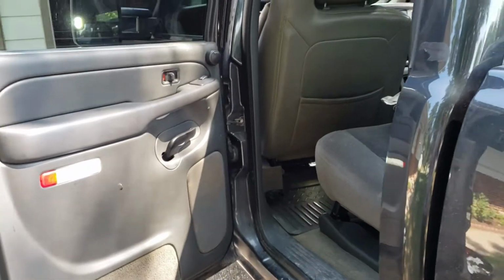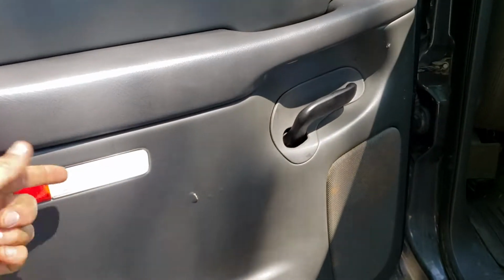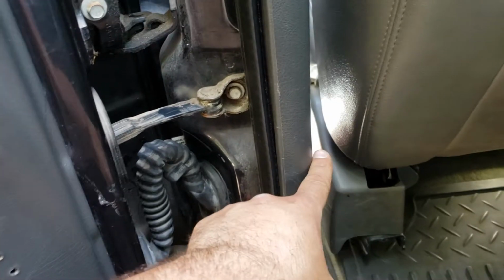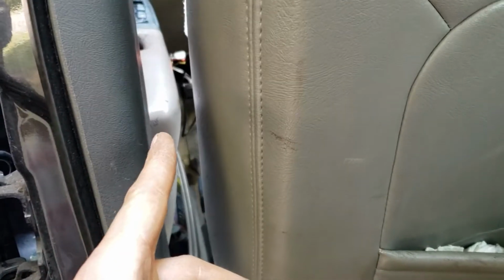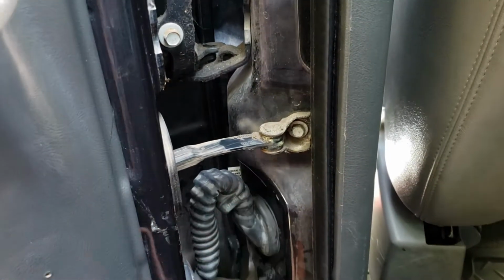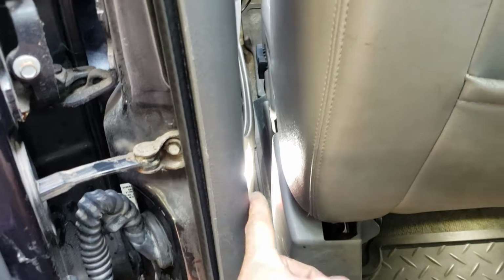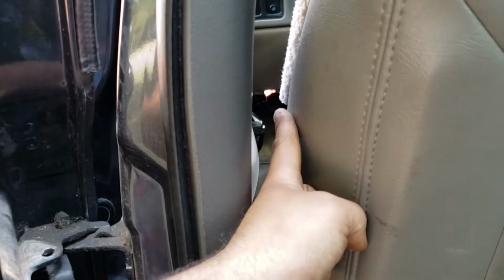So anyway, I had the plugs and the wiring, so I ran it through the door, and when it gets to here, the factory body harness has plugs that plug into this. This is one big plug, whereas like the front looms, there's just wires running through here, and wires come out here, where it's just a plug with pins and stuff. So I had to pin the light wires in here and pin them over here, and then I tied them into the floor light up there, which is tied in on that junction block.